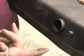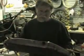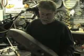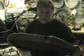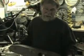Got a few things we've got to figure out, but the biggest problem, of course, are these, the fuel tanks for this Power Plus, and they've got some rust on the inside. So what we're going to be doing is putting Rustico in this, getting the rust out. We'll seal them on the inside. Then we've got to paint them to match, probably some kind of spray can job. But today's list: carburetor, cables, a few little pieces. We're going to have this bike running today.